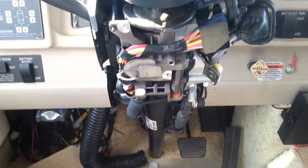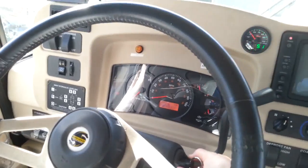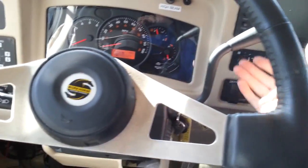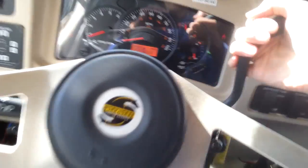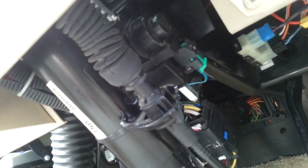That's all you have to do to get that off and take your plastic off. I think I've got this project all wrapped up. You can see she starts up, won't go in gear, push the brake pedal and she goes in gear just like she's supposed to. With all the plastic back on you can still get to that little solenoid switch pretty easily as long as you lay on the floor. Remember: pop that green piece out and push on that little black piece to override it if you lose your click and can't get out of park. Hopefully this will help somebody out — have a great day!